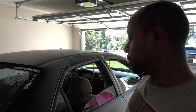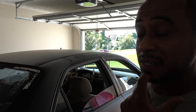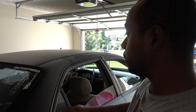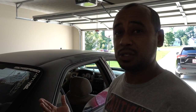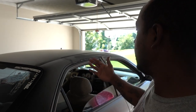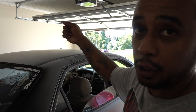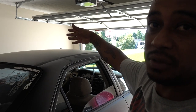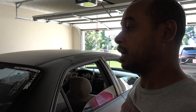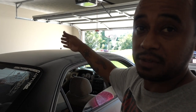I'm going to show you how to remove it, but if you try to do this, make sure that you have new clips. I don't think I'm going to be able to save all the little clips inside this trim. In case you need to replace it, because sometimes the keys get inside, you pry it on the door and all the trim on top of it gets damaged. It happened to me on the driver's side — I have a spare key, but my trim on that side is already damaged.